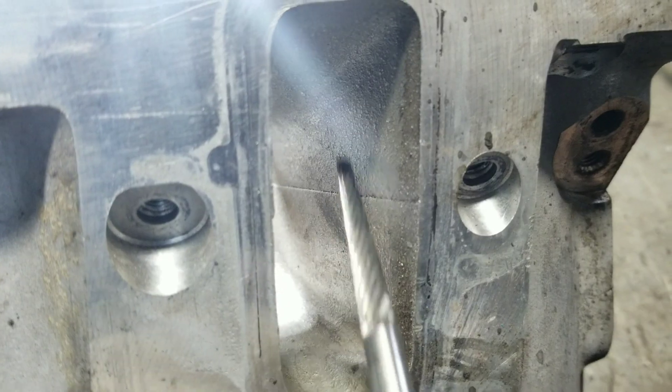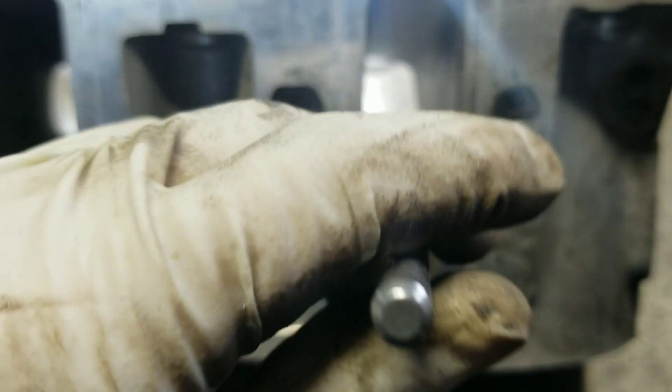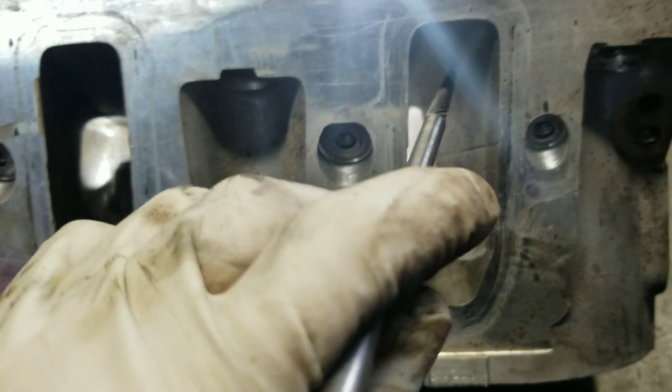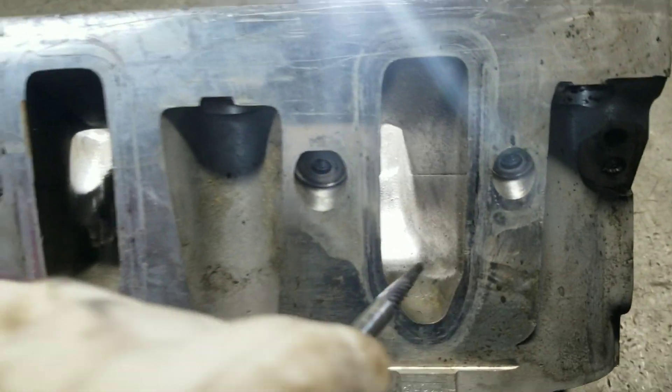We're going to remove this one right here. You're going to smooth this casting line in here — you see all the roughness, we're going to get it smooth. This part right here, we're going to get them smooth. This line in here too, we're going to erase it, get it smooth. Always the roof — you can take some meat on it, some material on it. On the floor, don't do much on it. Just clean it out, make it smooth. Don't take any material off because if you do, you're going to make a hole and then it's going to start passing water. So that's on the intake side.